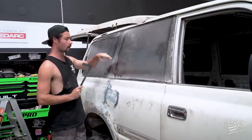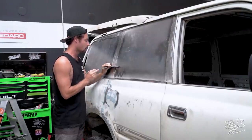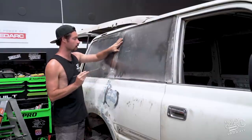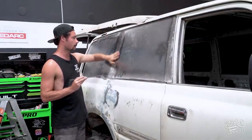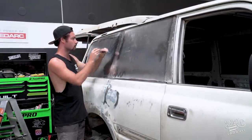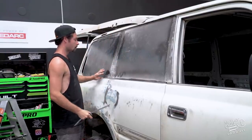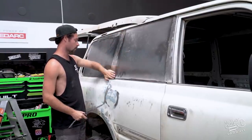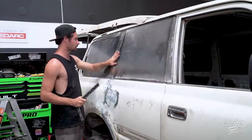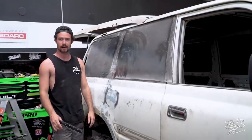Thanks to Macca for doing the welding around these panels. We're getting very close to the finishing end of this panel truck. I've just put a ruler across here and mostly down the bottom is a low spot, which is good - I can fill it with fibreglass and bog to get it looking smooth. Near the bottom and top there was a little bit I had to take off with the grinder on the original panel to get the level right, but it's looking pretty good. I'm going to throw a coat of body filler on, sand it back, find the high and low spots, throw some primer on and see if it looks like a half-decent paint job.